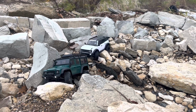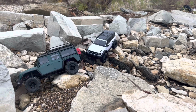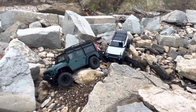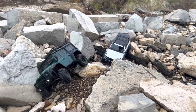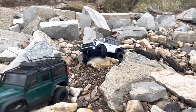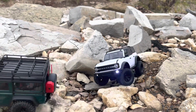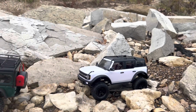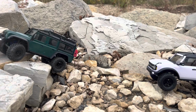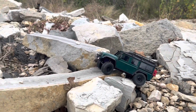They are 52 millimeters long, eye to eye, when they are extended, and they only collapse down to 39. So that's huge, right? That is way huge. If you didn't know, the normal 32 millimeter shocks, if you get the stock shock or any of the quality aftermarket upgrades, aluminum shocks, they will collapse down from 32 millimeters to 22, 22 and a half, some of them.